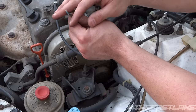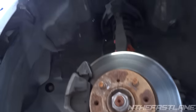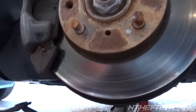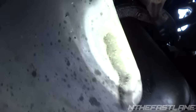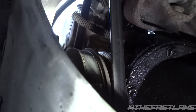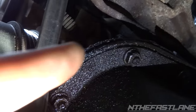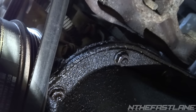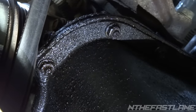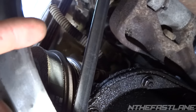What we're gonna do is push the wire down and either solder it or use some 3M connectors. Under here on the driver's side, you take off the tire and come up under here. This is the oil pan, and you can see right there the wire that got cut clean off. That goes to the crank positioning sensor, which sits right back in there underneath the timing cover — so it's kind of tough to get to.